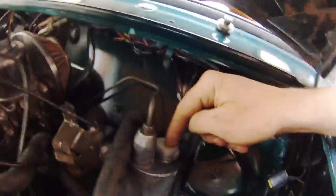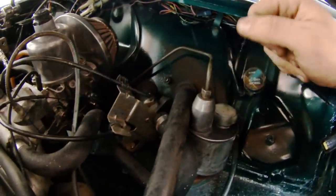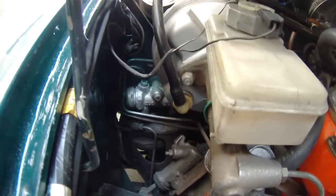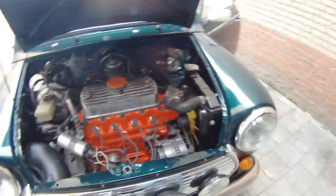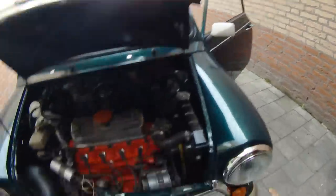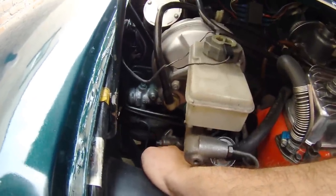After that you can put the clevis pin back in. If you took it out, you can go ahead and replace it as well — I took mine out because I was doing all the engine work in here. Hook all your lines back up and then go ahead and bleed your system. To bleed your system, you can either use a bleeder bottle — basically a vacuum line that goes into a bottle with brake fluid at the bottom, which will suck the brake fluid in and push it out, clearing all the air bubbles from the line — or you can have somebody inside pumping the clutch pedal while you manually turn the bleeder valve. Every time they depress the clutch pedal, that will also get the air out of the line.